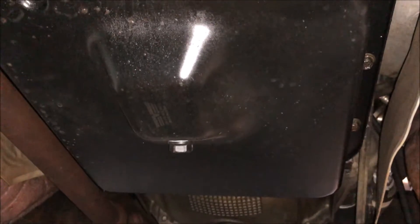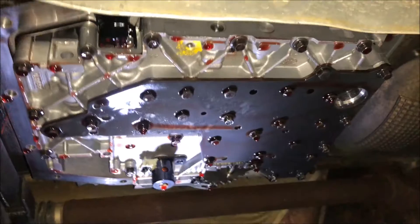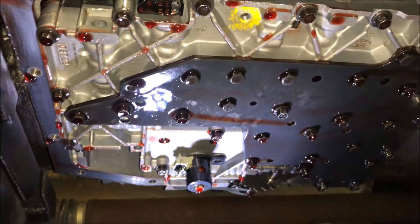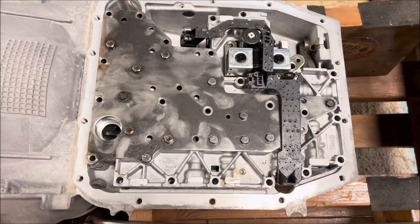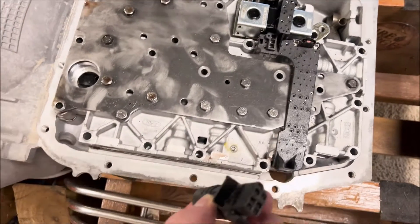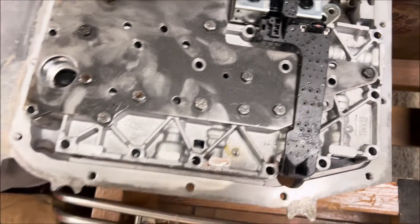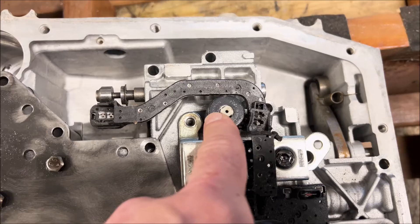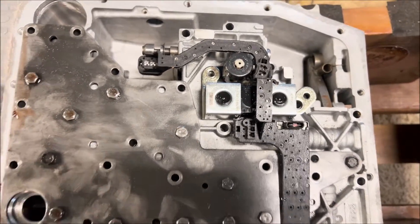First step: I'll pull the transmission pan. You can see I've got a Dorman unit here with a drain plug — I highly recommend getting this. It's one of the best things for doing any transmission work. With the pan and filter off, I've taken off this shift solenoid pack. It goes right where the torque converter control solenoid is — two bolts hold it in. I've got the old Ford unit that was not bad when I replaced the other one, and I'm going to put that in. I failed to film when I was pulling off this electrical strap. Here is the electrical that goes through the case — this is what connects to your ECU. First point of contact is the shift solenoids, and you've got the torque converter control solenoid and the EPC solenoid right here. That strap has to come up to get the shift solenoid out of there.